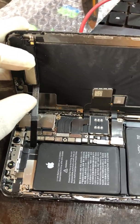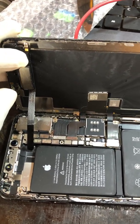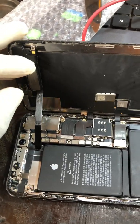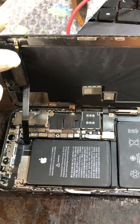In most cases, before you conclude that the phone needs flashing, make sure you disconnect the earpiece flex on an iPhone XS Max first, before you conclude it needs to be flashed.